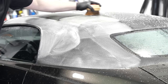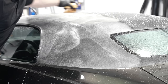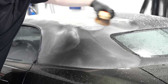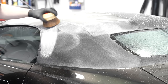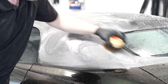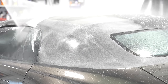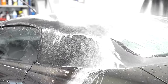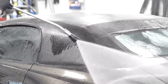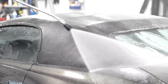The 303 brush works fantastically well — as you can see on screen, it makes the product lather and foam up. Apply the cleaner at temperatures ideally over 20°C (68°F) — basically room temperature — for the best efficiency. Work it in thoroughly to cover every single square inch of the fabric top. For severe stains, as long as you're not in direct sunlight, you can let it dwell for up to 15 to 20 minutes. Then thoroughly rinse away — the cleaner rinses off freely and easily. Use a garden hose or pressure washer and be very thorough.